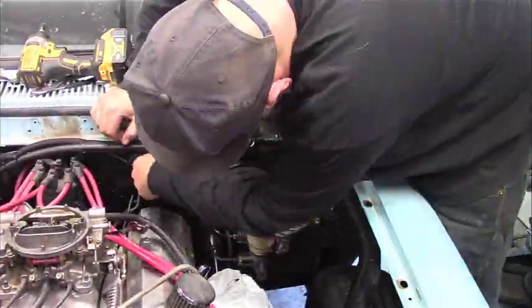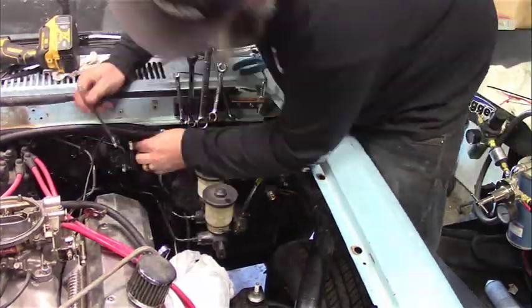I've gone ahead and put it back to stock - we're starting all over. The first thing we need to do is disconnect the lines to the front two wheels from the proportional valve. Now that both lines are disconnected, we need to plug one of those ports off using an inverted flare plug - that's not something you pick up at a hardware store, you'll need to go to an auto parts store. I'm going to Teflon-tape it anyway just to make sure it doesn't leak. The other open line becomes our feed line to the line lock - we need to create a line from that open port on the proportional valve to the inlet of the line lock.